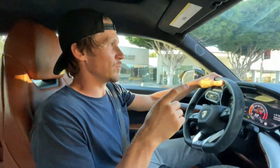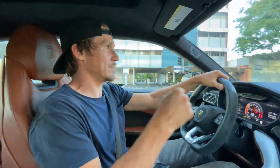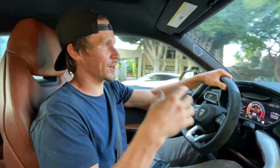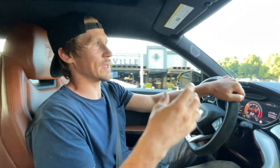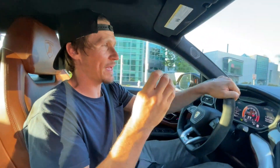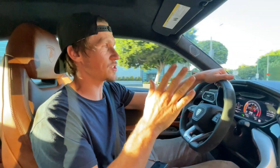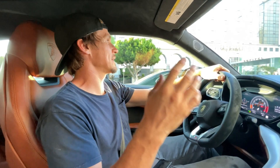When you brake on the street, you don't get them up to the temperature that they're designed to operate. They're designed to be braking hard on every corner and getting very hot. So because they don't get that hot, they don't actually burn up — that's where the no dust comes from. And when they don't burn up, you have a pad layer, that top layer that touches the rotor, that goes through what's called a low heat cycle.